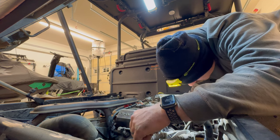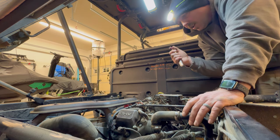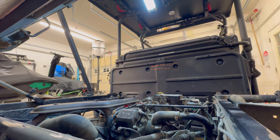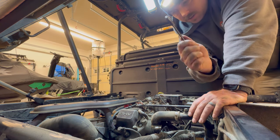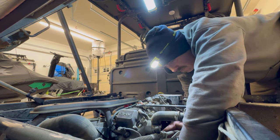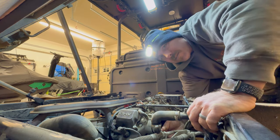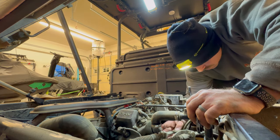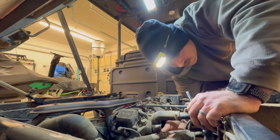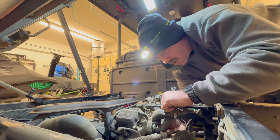Best way for this — you're going to have to use a wrench, ideally a ratcheting wrench. I do have a 10 mil ratcheting wrench; if you don't have one, these things are awesome. I'm starting to get some coolant coming out of the thermostat housing, so that's where my catch can comes in. There we go — all popped right off.